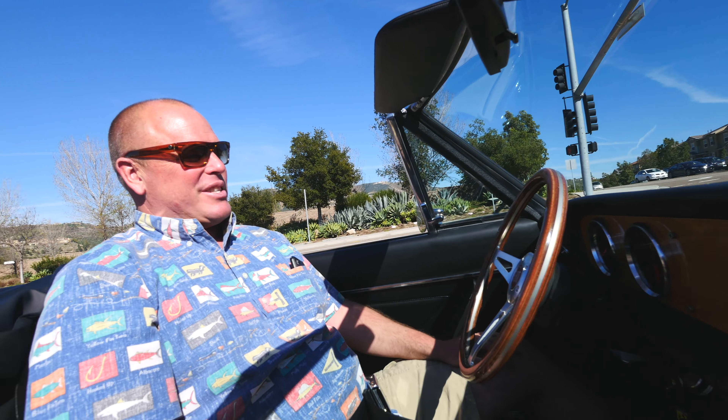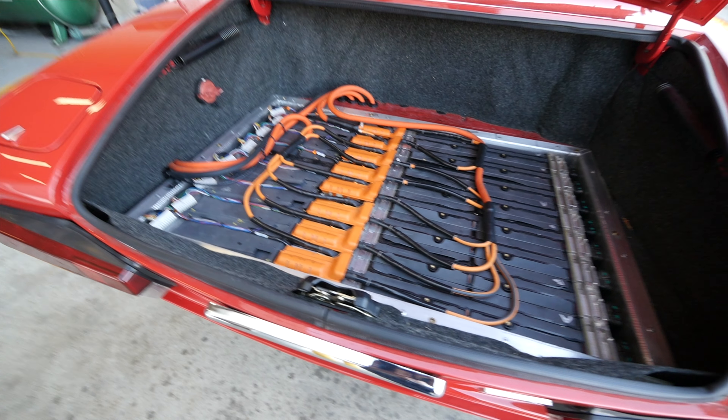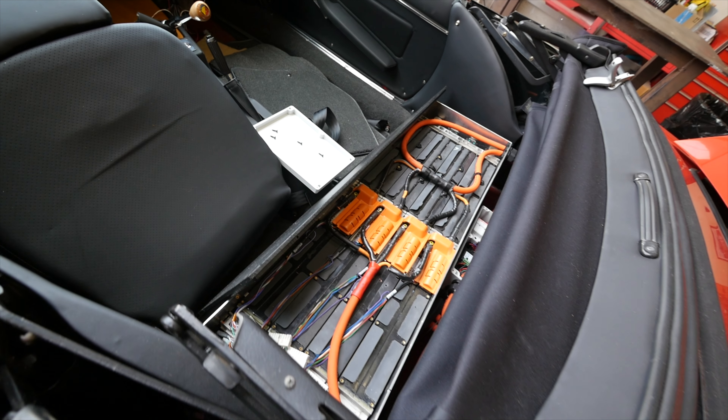It was 76 seconds to get to top speed at 103 miles an hour for this car. Now I'm pretty sure it's probably going to be around 30 seconds or less — it's gonna be really fast. We're going to take this to a track pretty soon just to test it. All that power is using Tesla modules — smart Tesla modules, first generation. That's a real stable chemistry. The modules are about eight years old with literally like 2,000 miles of use on them.